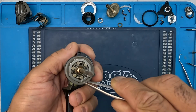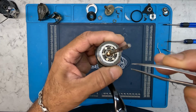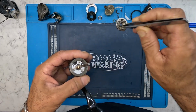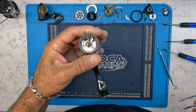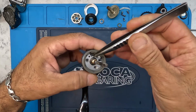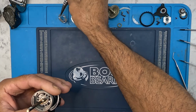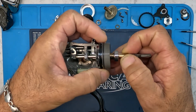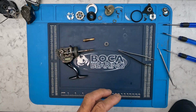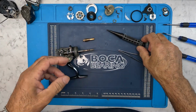We'll clean it up as we go back in, because there's screws under there holding the bearing down. I hate taking this out. It's all in one piece. There's the 3 screws. If you're not sure when you take the stuff apart, take a photo of each step. That bearing looks alright. Feels smooth. Oh yeah. We'll clean them up as we put them back together.